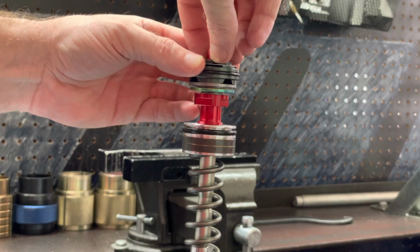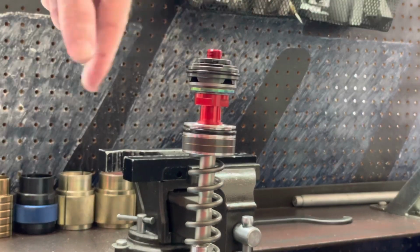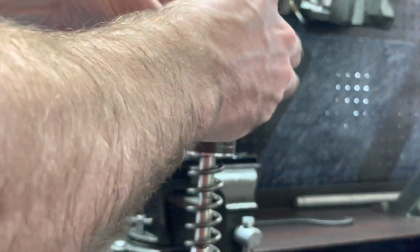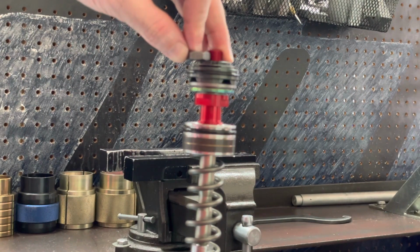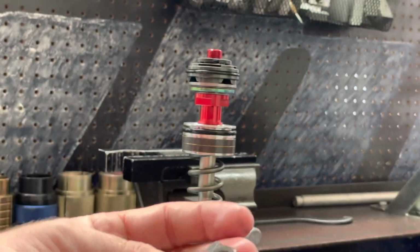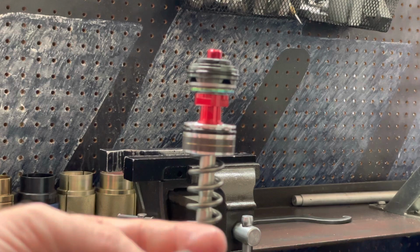Cool, make sure to line everything up and not to capture the edge of the shim while installing that, because this washer fits into the recess of that piston. And now you can see we have some threads left, and it is just about the perfect amount that matches how tall our nut is. So now we're going to verify that our nut has clean threads on the inside. There's no oils inside of there, because next we're going to apply a layer of Loctite to that and then torque down our nut.